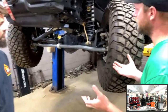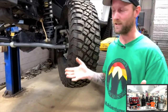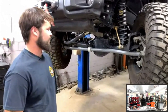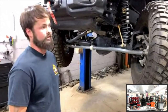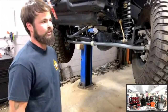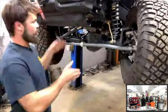The sway bar is a debatable topic. If you're driving near mountain roads like the Blue Ridge, you've never experienced a Jeep without a sway bar — take it off and go drive it with family in back and you'll understand quickly. This JL has a disconnect sway bar — a longer sway bar link so that when it droops it doesn't bind. The bar itself twists as you go down the road to resist body roll, improving road manners.